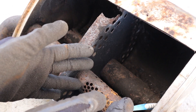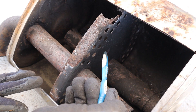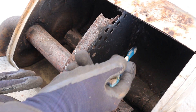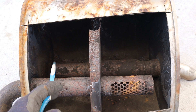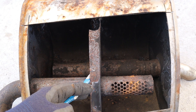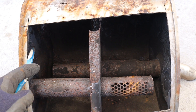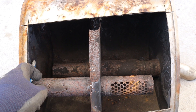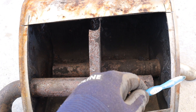The distance between these walls is specifically designed to cancel a certain wavelength. Finally, the exhaust is then going to flow through these little holes on the bottom and top side into the front chamber. The front chamber, similarly to the rear chamber, bounces sound waves back and forth between these two baffles, once again causing destructive interference. Eventually the exhaust gas is going to make its way down through this pipe and then exit out the tailpipe at the back.